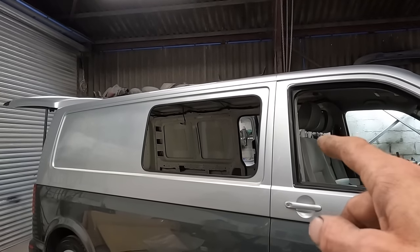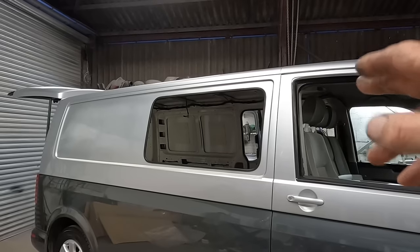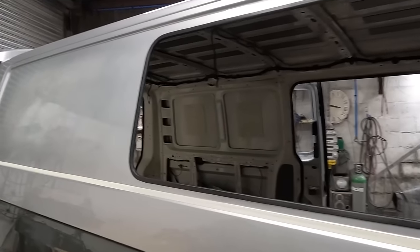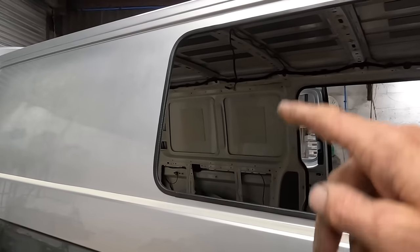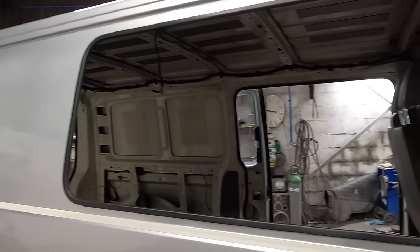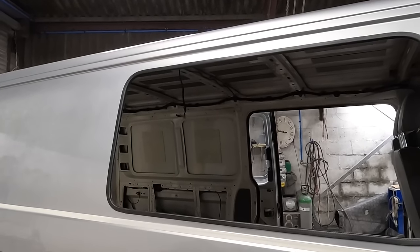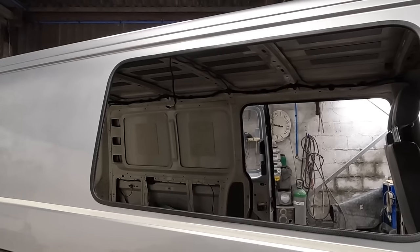It is the following day. I spent a bit of time cutting the hole out and making it nice - hopefully you saw in the time-lapse. We cut the top and bottom with a grinder, then I went round it with the air saw, and because we cut the blade down it went round the corners nicely - really happy with that. I die-ground the edges, made them nice and square to the inside lip so it all sits nicely. I then put some acid etch primer on it. I've got the kit out, let me show you.